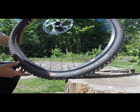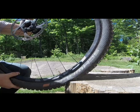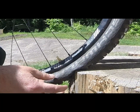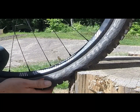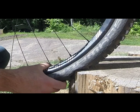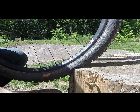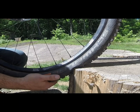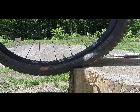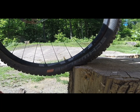So it's interesting to look at the fact that with this empty tire, you can see I can put a fair bit of pressure on it — I am leaning into that quite hard — and it's not bottoming out at all. I'm still maintaining that cushioning in between the wheel and the tire. This is completely empty, which obviously would be an issue if I don't have anything in there at all. So it definitely does what I expect it to do. While it may not protect as well as a real CushCore, it's definitely performing the task here. It's definitely allowing me to decrease my pressures — even from a really low pressure to start with — into around the five pound range lower. So it is absolutely protecting that tire and achieving what I want, which is a low-level performance increase for low dollars, and it's entirely worth it.